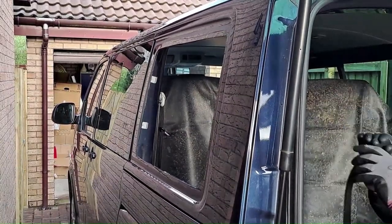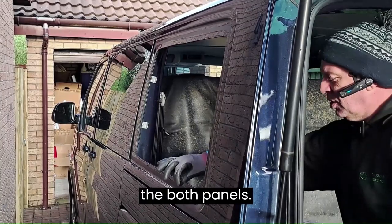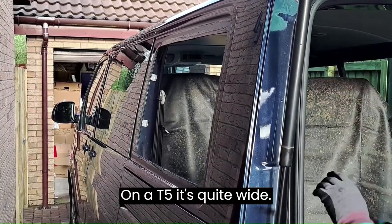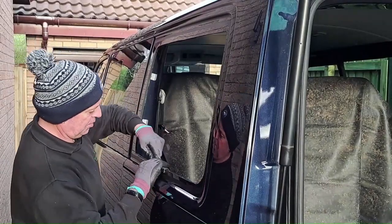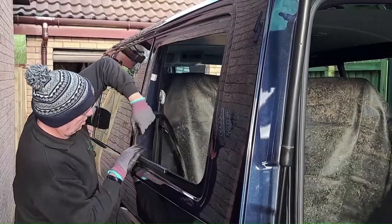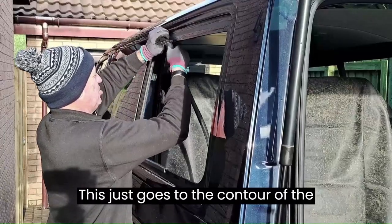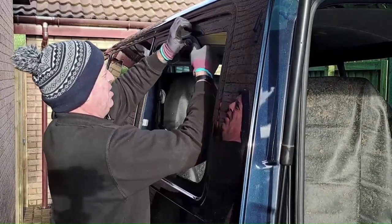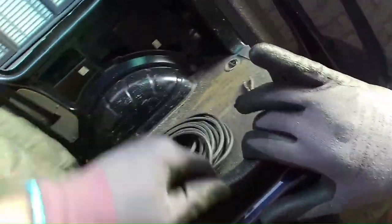I'm going to put this edge trim on now. This is what we would class as an extra large edge trim — you can see how wide it is. It covers both panels; on a T5 it's quite wide. It's really important that you get a straight edge with the bodywork, because this trim just follows the contour of the metal edge. If there are any dips or raises in the metal edge you're going to see it once the edge trim is on. That gives it a nice neat and tidy finish.